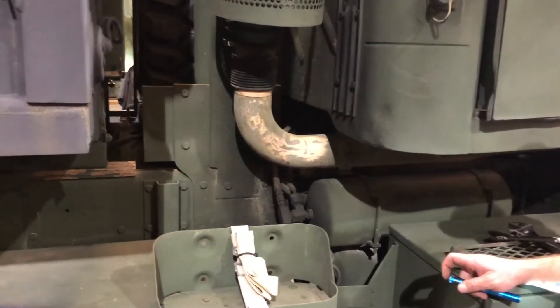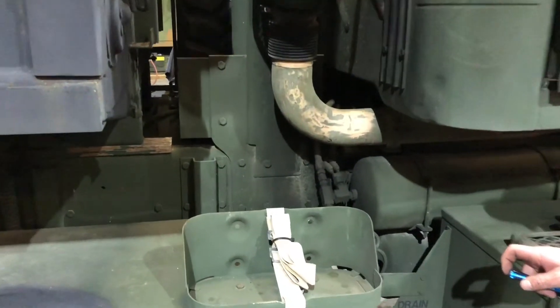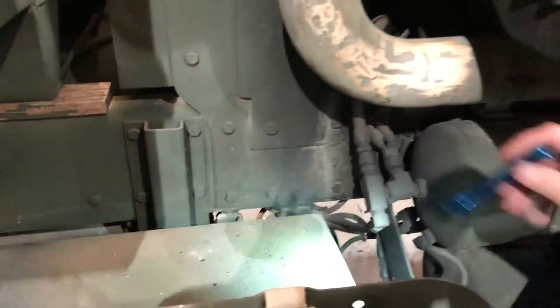That's how you do the rear central tire inflation. There are still a couple of things we've got to do. There's a T right in here on the tank that you're going to have to remove — this is what feeds the whole central tire inflation system with air. If you don't remove that, you're still going to be getting air going to the hubs.